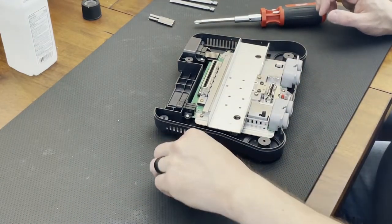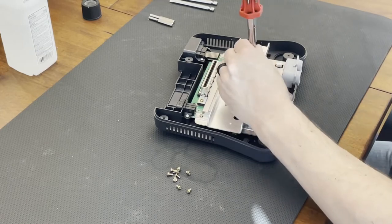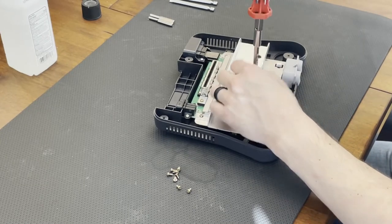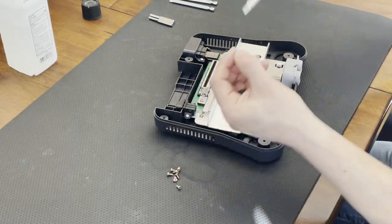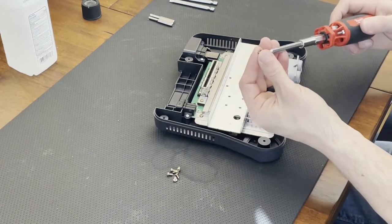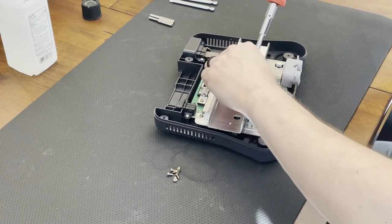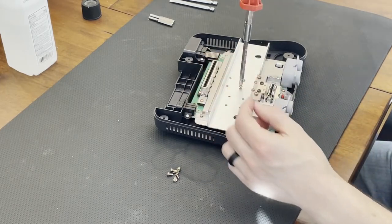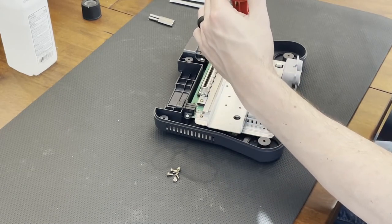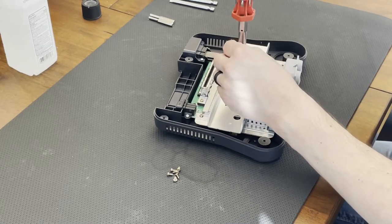All right. Get these heat sink screws. Another thing too, when I start these, sometimes they feel like they'll get resistance on the thread. If you ever get that, feel a little resistance, you should have none. Immediately stop. Like for example, I'm gonna come in wrong with this screw. And so let's say I go in and I feel some resistance, which I just did. Just back out until you hear the notch or you feel it. See, you could hear it and I felt it.